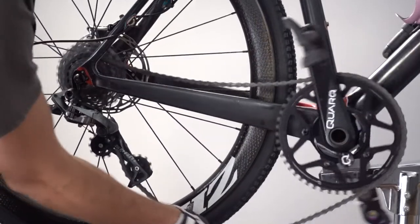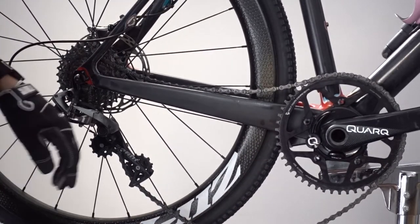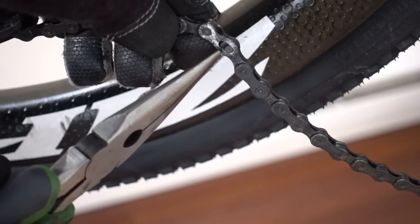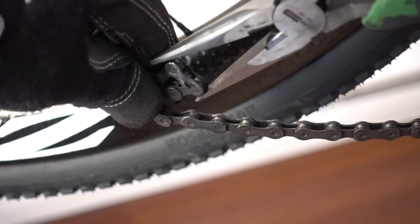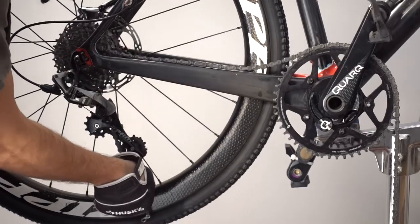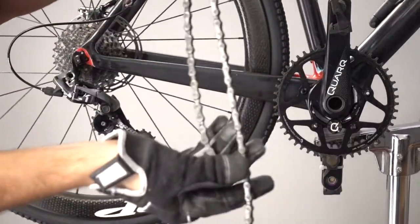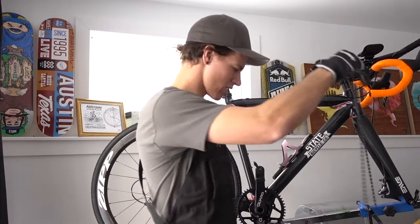You need to take tension off this chain somehow. Once you get to that point, you're going to rotate this chain around like this. This chain has a quicklink pin in it — this is what's called a quicklink, which is basically the newer version of a masterlink. You see it's got this groove right here; that's because the pin actually slides in there. So all we're going to do is take this old chain, fold it in half just like that, then go from opposite edges and snap that back together just like that. Now that you've got the chain unlinked, you can simply remove it. And that's your old worn out dirty chain — make sure it's nice and knot free.